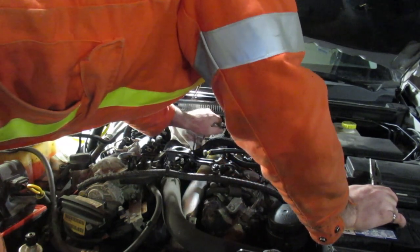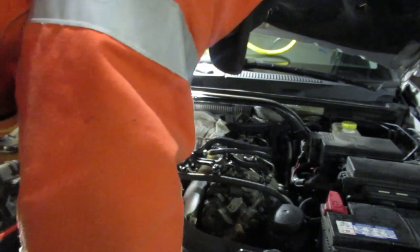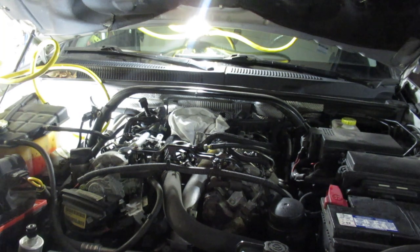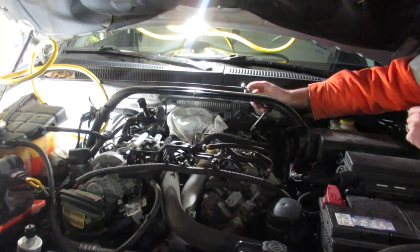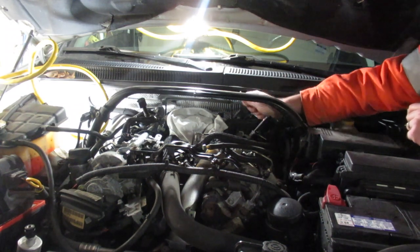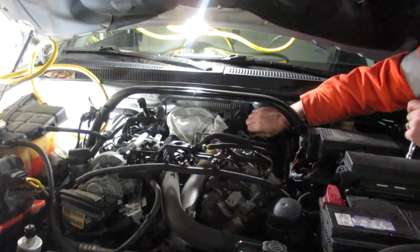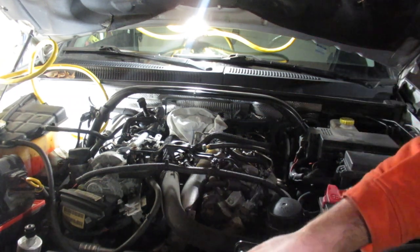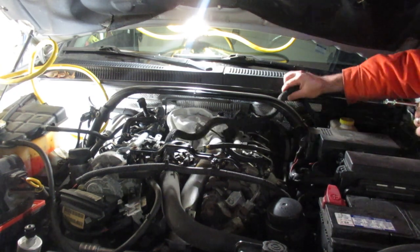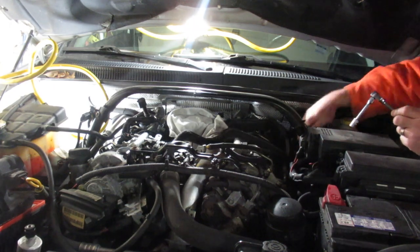Reorganize the wiring a little bit. That wire is only about an inch long — that's a challenging one. There's a hook here for lifting the engine that shouldn't be in the way. We need to move this electrical harness. It's always good to take the time to give yourself space to work rather than struggling with it. The vacuum line for the brake booster runs to a vacuum pump on the front of the engine — if it gets really annoying we can take it off.